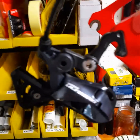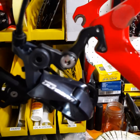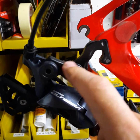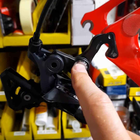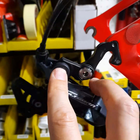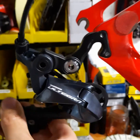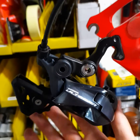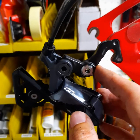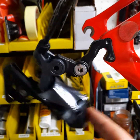So you have to really Google what direct mount is. Eventually you'll figure out that direct mount isn't about how the derailleur is mounted — it's about where the derailleur is mounted. The idea is that you're bringing this pivot point of the derailleur further back in the bike. That's to accommodate bigger cassettes, so you can get a short cage derailleur that can still go up a much larger cassette because it's further back. It also has a secondary benefit of making it a bit easier to drop your wheel out, giving a bit more space.